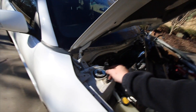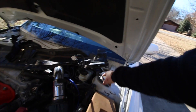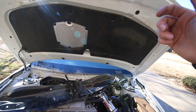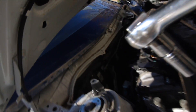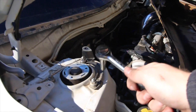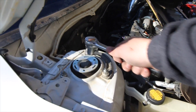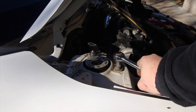These are actually 14 millimeter bolts, not 10 like I thought throughout — they're actually 14. So just take those two out, take this little bolt piece out, same thing on that side. Fortunately, my strut bar only needs these two bolts, not three. These are really hard to do.